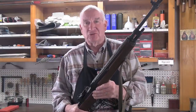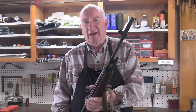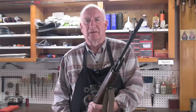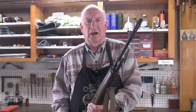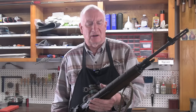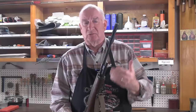So there you have it. Some gunsmithing jobs are really not jobs at all — they're just a matter of understanding how and why. This happens to be one of the simpler jobs you'll ever run across. Very, very easy to do with common tools. You can use a steel drift, but the trouble is it can really do some serious damage to the gun without much difficulty. Steel drifts are hard and tend to be brittle — you can snap or bend one very easily. So get the appropriate tools; they're inexpensive. You can usually buy nickel silver rods in lengths of six to ten inches. Even the loosest front sight will be easily tightened up using that simple process.